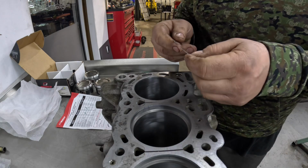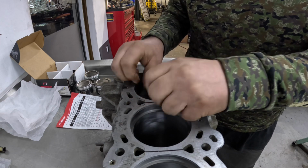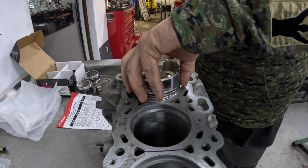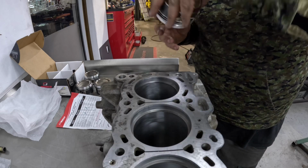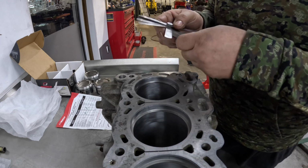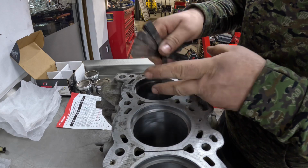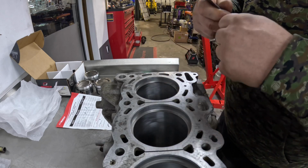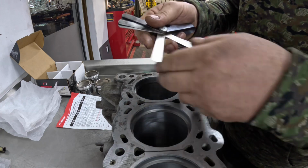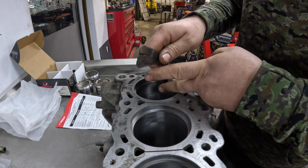So this won't be at the right size yet because I've only taken, well, it was 7 thou that I took off it, but it was more to make sure that the gap is machined correctly. So I'm going to start over at 15 because we had a 12 thou gap and I've taken plenty out, but we'll start still below so we work our way up to it. And then you can see that I'm just making sure the feeler blade is clean every time I fit it.